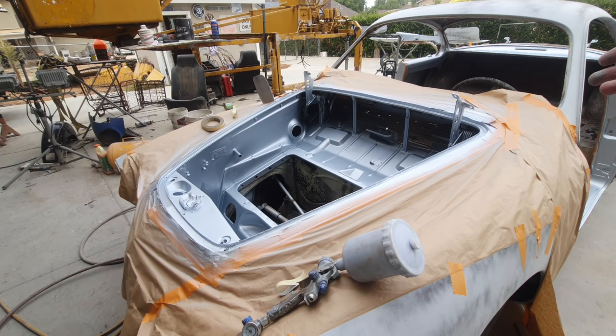We used to do that with acrylic enamel when it was metallics, to get it to lay down and look even. Okay, that's how you did it. And you had to use the slow thinner so that it wouldn't dry spot. But if it dry spots a little bit with the base coat, it's almost better to have it a little bit too dry. You don't want it super dry with too much stuff standing up, because then those shadows will show up.